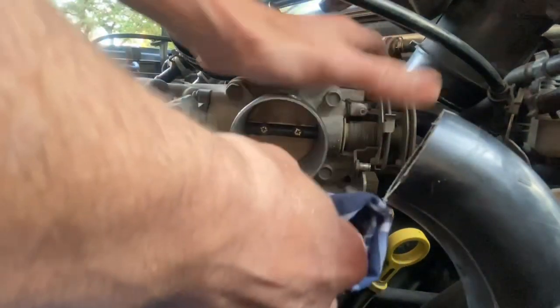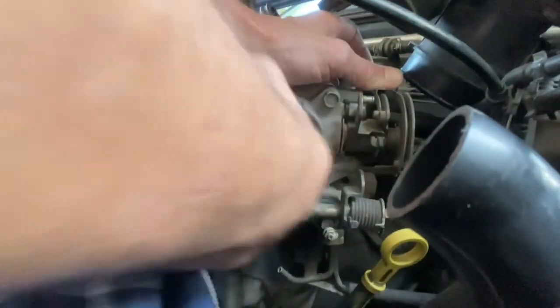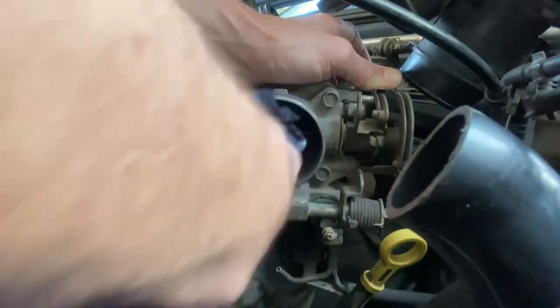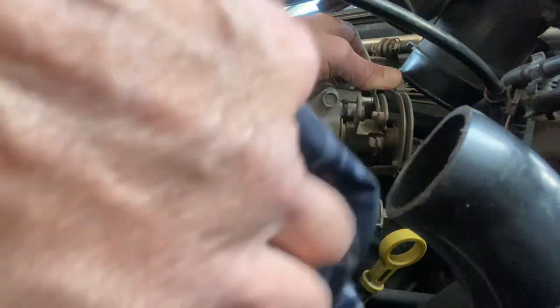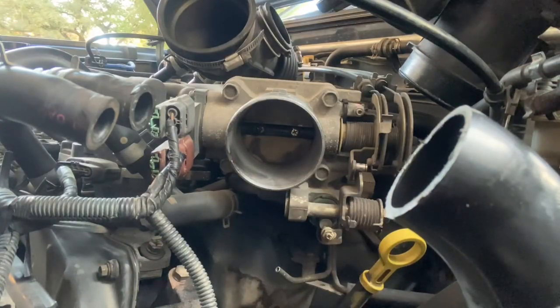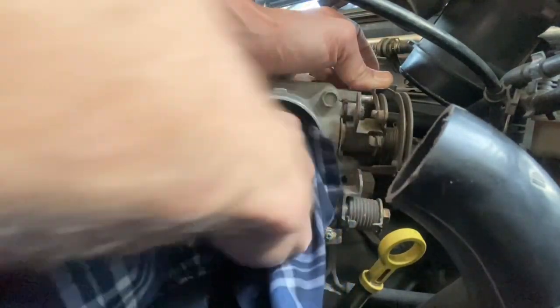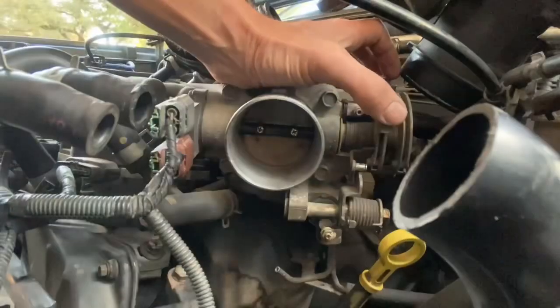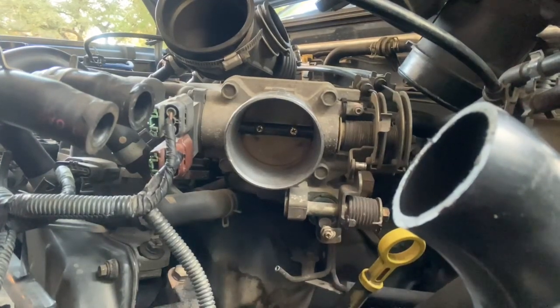You do want to get most of the stuff that's causing it to stick. Rub your hand around it — you don't want to bend anything, so be kind of careful. A lot of this is done by feel, because you're not going to be able to see what you're doing in there. Now to get the other side of that butterfly — I've gotten the near side and where it seats — I'm going to fit my finger way down in there and feel the other side of that butterfly, going right around it. I'm going to go on the bottom, then on top. This should be good for a while. It shouldn't stick anymore. It should make a nice tight seal when it needs to, and that's going to tell the computer to maintain idle at the right idle speed.